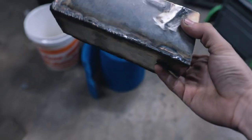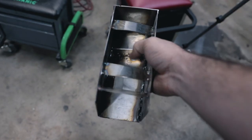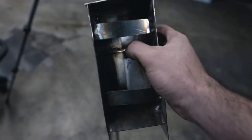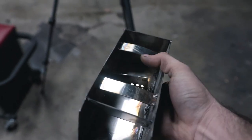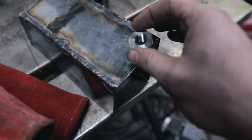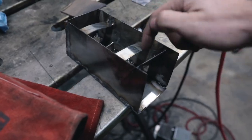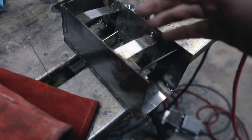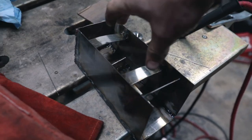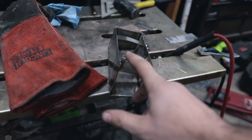We're making good progress. I put the baffle in and also added a piece at the bottom with drilled holes to help prevent oil from sloshing around — you typically find these in fuel tanks. I have two pieces so my filter can rest on them. I'm now getting the corner piece made that gets welded to the bottom corner, and then we can get the front piece welded on. For the top, I'll cut the measurements from the stainless sheet, drill four holes, connect them with a grinder to make a nice big opening so the filter can be pulled in and out for replacement.